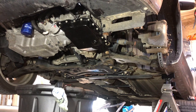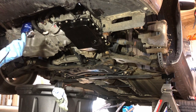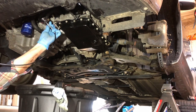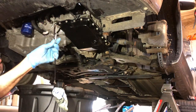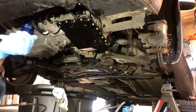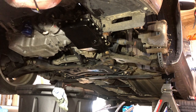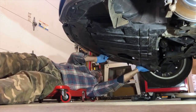I've taken the tubes out of the circuit and replaced the tube back on the transmission cooler. Now we're going to re-clamp it. This time I'm going to put the clamps facing down to make it easier to get off in the future, so you won't have to use the fancy clamp tool. That is back on and tight. I see no evidence of leaks underneath. We're going to leave this marking here because we know it's correct, and next time we can just use one tube connected right here to flush out the transmission. Skid plate reinstallation is the reverse of removal.